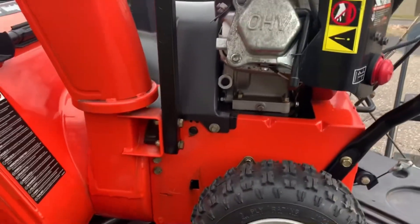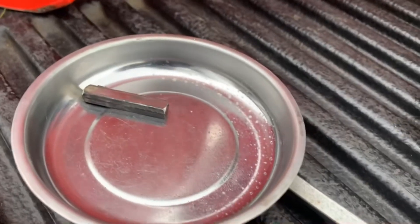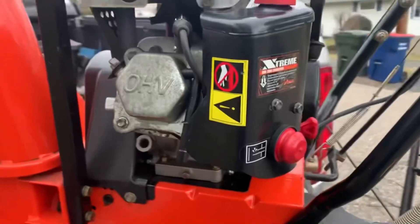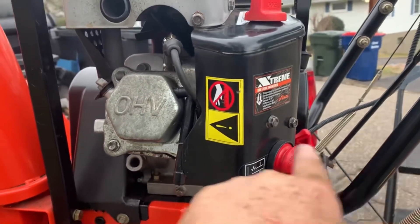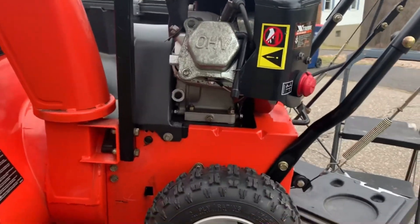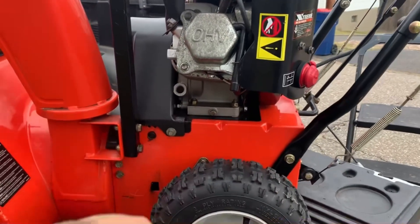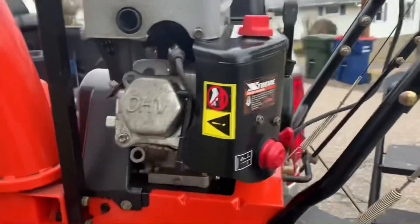I drained out a little bit of fuel — a little bit of water. You can see there are water droplets and some dirt. I asked him what the leak was like, because a lot of people don't realize that when you hit the primer on most snow engines, fuel will come out. He said no, it was dripping constantly. What could have happened is there was a little bit of dirt holding the needle open, and when I loaded it in my truck I jarred that piece of dirt loose.